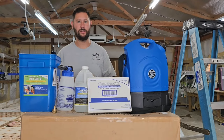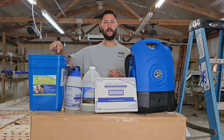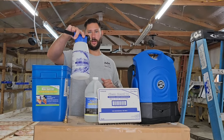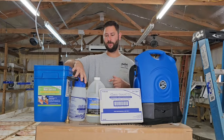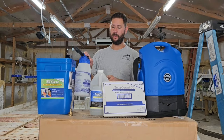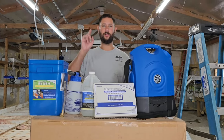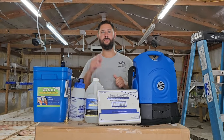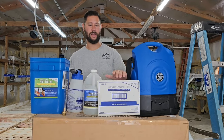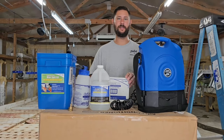Tools and cleaner I'm going to use to clean this four-way ceiling cassette. First, get a bucket — this bucket comes with the Complete Care mini-split kit that New Calgon offers. I'm going to use the coil gun because I don't want to pre-mix my chemical. I'm using the EVAP Fresh No Rinse; I don't have to dilute this — I'm going to put this straight into the coil gun. This is New Calgon's cleaner for cleaning indoor air handlers and mini-split ductless air handlers. I'm using the maintenance bag New Calgon makes — this is the Clean Guard CC Professional Ceiling Cassette Maintenance Bag.